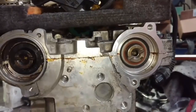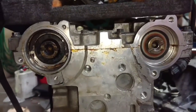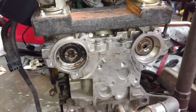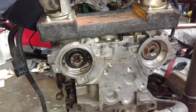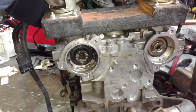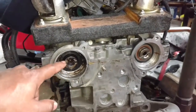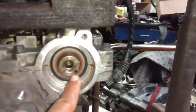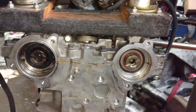That's why it's variable timing. The sensor could actually make the timing adjust while the engine's running and it has somewhat of an adjustment. These are interference engines, so you don't want to be too far off on the timing or you'll have problems. If you have decided to try to do this without the cam locking tool, you more than likely are not going to get that right. Without the cam locking tool, I have no advice for you at all. Get the cam locking tool, install it — intake cam numbers on the bottom, slots offset to the top, exhaust cam numbers across the top, the slot offset to the bottom, and this one actually has a notch in it.